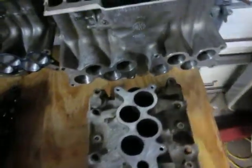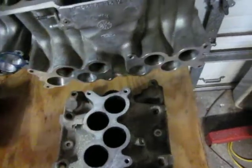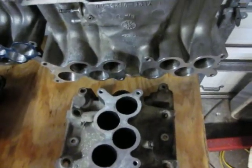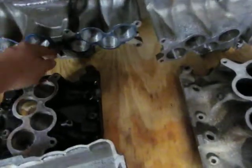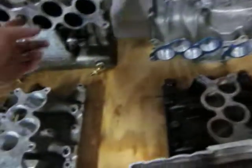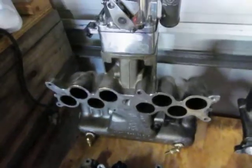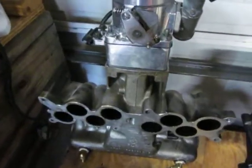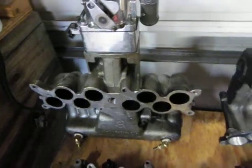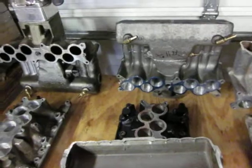These inlets in the uppers have no port for it, so it keeps the heat out. That EGR port goes from in here and then it comes out up here to the throttle body — that's where your EGR spacers get all the heat, and then that gets transferred into the inlet charge. So to keep your inlet charge cool, you'll make more power.